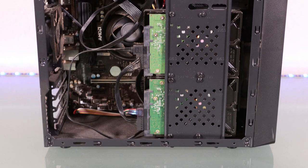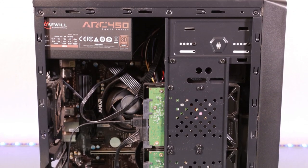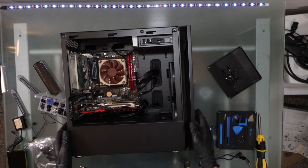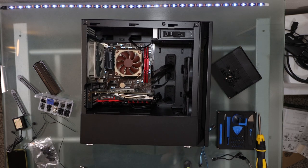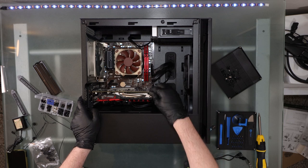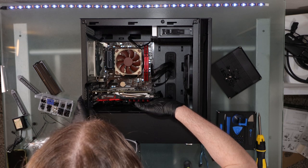For the case, I started out with a cheap $20 micro ATX case with one intake fan and one exhaust fan — super flimsy and very cramped. I recently upgraded to a Cooler Master Silencio 400 with a noise-cancelling side panel. The case has more airflow but the sound-dampening panels keep it really quiet. I also have Noctua and BeQuiet fans along with a Noctua CPU cooler. One thing to be aware of: it's very hard to find cases with an optical drive bay nowadays — it took me a while to find this one.